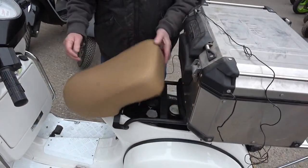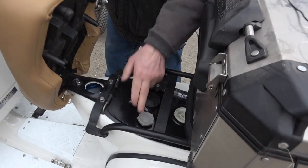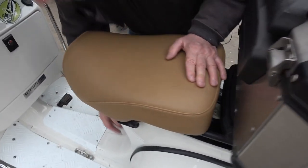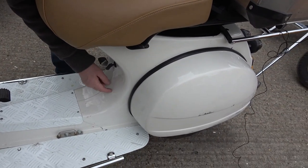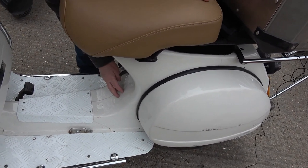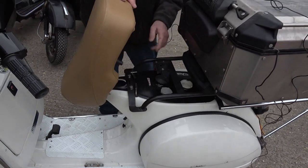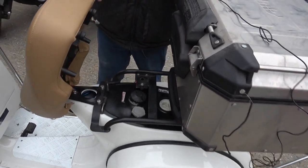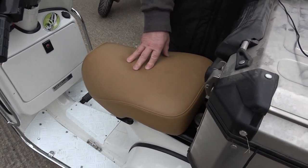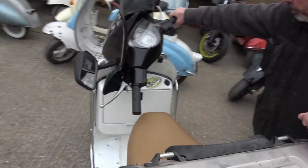The seat is one of the posty bike seats — a single saddle with a lock, giving access to the petrol and oil. There is oil injection on this. It's not got the window because I blocked it up inside and here, as they actually get smashed or damaged and cracked when sitting out. So he just has to look into his oil tank and make sure it's topped up. These seats are really comfortable — loads of foam — and will be very useful for long trips between cities.